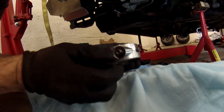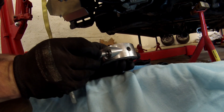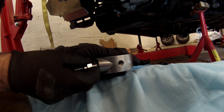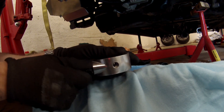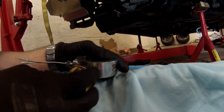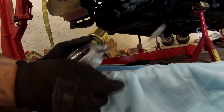The first thing you have to do is remove the plugs where your sensors come in. I'm just doing this for illustration purposes because I don't have any sealant at home right now. You may want to use some kind of sealant or o-ring on your sensors to prevent oil from leaking out. Thread your sensors into the sandwich plate — this big one is the oil pressure sensor, and that is the oil temperature sensor.